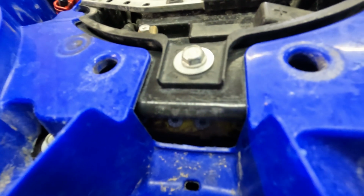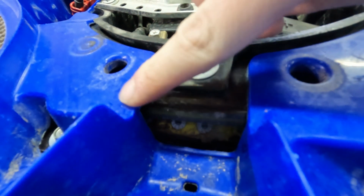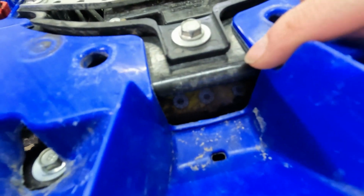So what I did is I got on my Vortex back here, and you can see those Vortex knobs in there. There are 3 knobs over on this side. There's 1 back here, there's 2, there's 3, and then this one over to the right is the map selector. This thing has 10 different maps on it. Right now it is on map 4, and all of the fuel trim settings were on 5, which is just middle of the road, about where they should be. That's where they were all set.